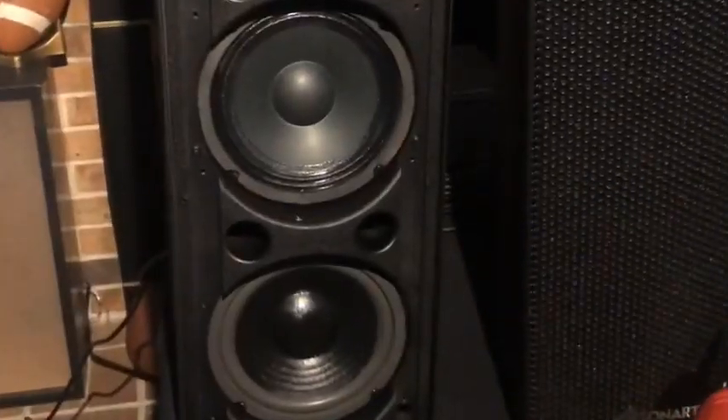Overall, I wanted to thank you guys for tuning in and also warn you: if you're interested in doing this, do it at your own skill level and at your own risk. Changing components in your speaker could affect your amp, could affect components in the speaker — especially if you don't connect wires right, positive and negative. You could blow your speaker or damage it. Be safe, make sure these are unplugged when you're doing all this.